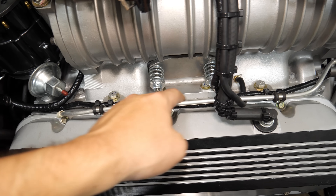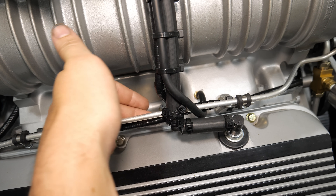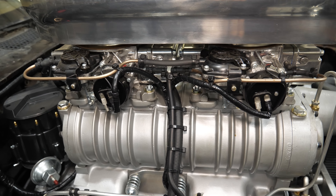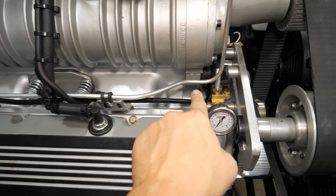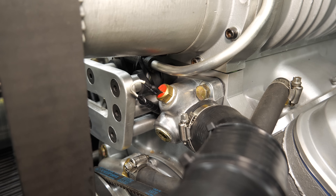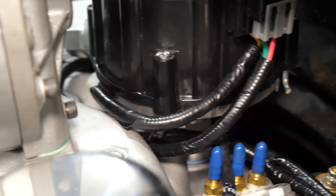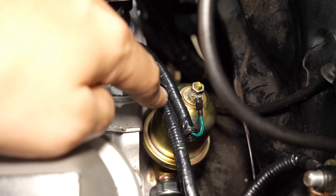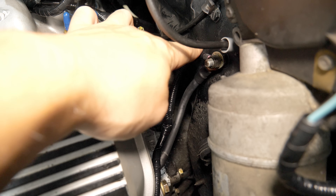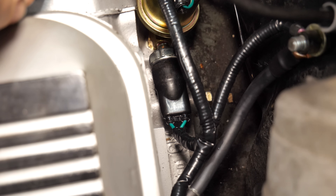This branch here comes forward along the valve covers — these are the mounting tabs I made when I thought I was going to have more of a harness here. There's another T in the wiring right here: one side comes up, splits, and goes to the two electric chokes. The other side comes forward along the engine to the temperature switch in the thermostat housing that's going to turn the radiator fans on and off. The other fork off this main section comes around the front of the distributor — down here for the oil pressure sender, the oil pressure switch, the coolant temperature switch, and a ground at this stud just for the oil pressure switch since it's not internally grounded and has two terminals.